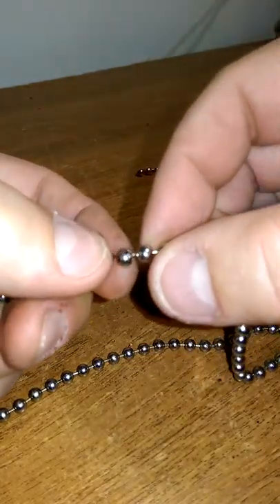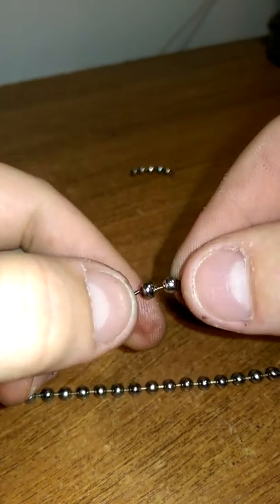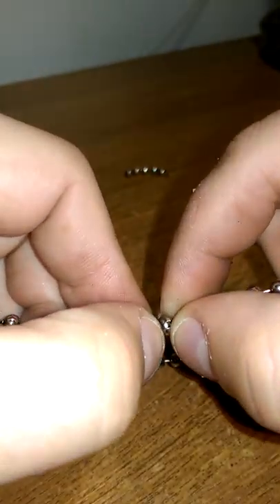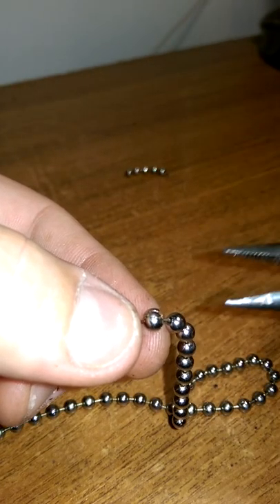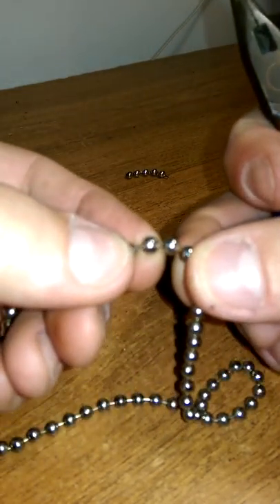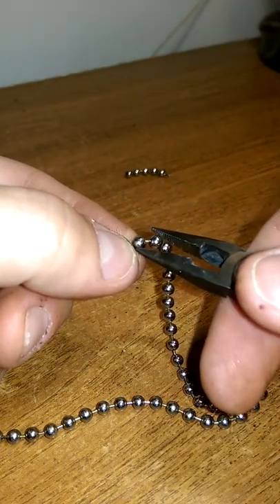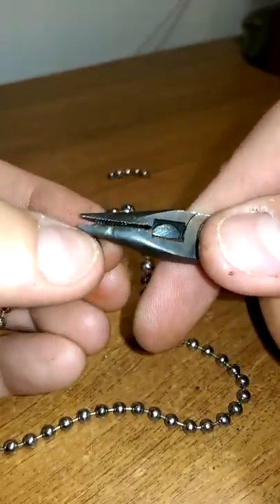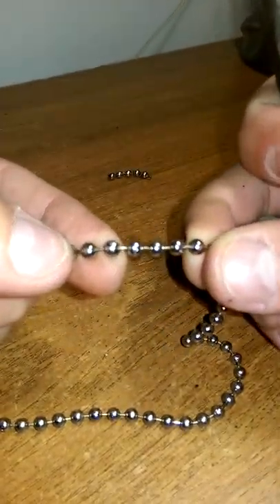Now it may take a little bit of finagling to get in there. Sometimes you might need pliers, other times you'll be able to just pop it straight in. Once we've got both sides popped in, we can just crimp it together carefully. A little bit of slack on the chain seems to work very well. Just squeeze it together — sometimes you might need to square it up again. Oops, too much. There you go, and then it'll go through the roller and everything.